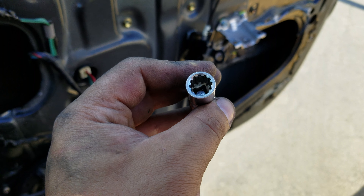Then take off the door handle screw using the Phillips. From there, take this plastic housing off. If you have big fingers and can't get in there, get yourself a small flathead or a butter knife, stick it in there, and pull upwards toward the roof and it'll pop. Don't be afraid to pop it — it comes off easily. If it breaks, the stoppers may have become brittle over time.